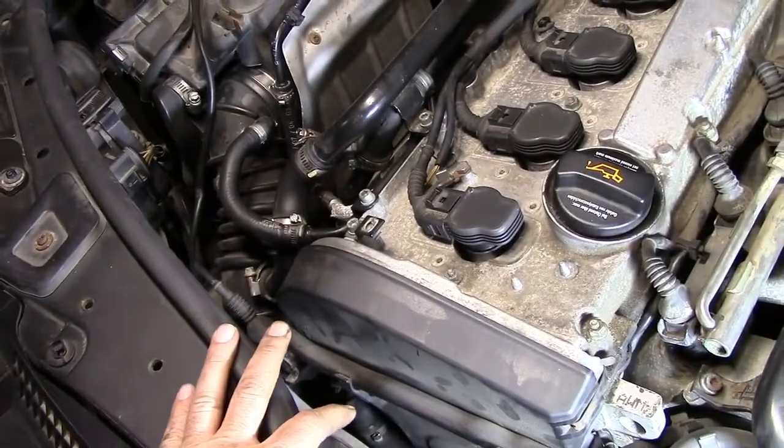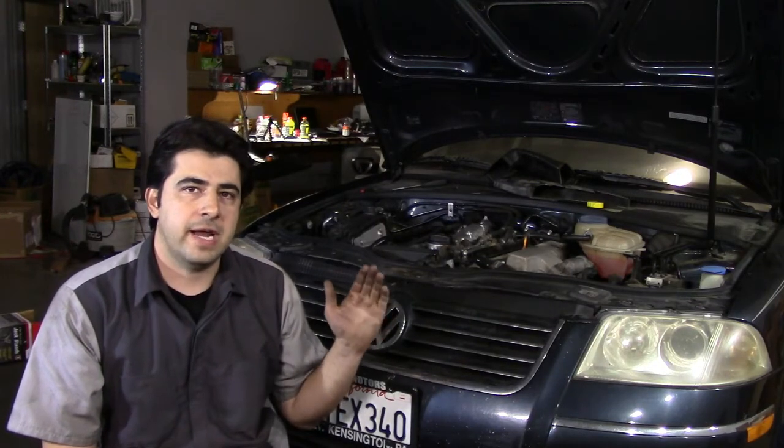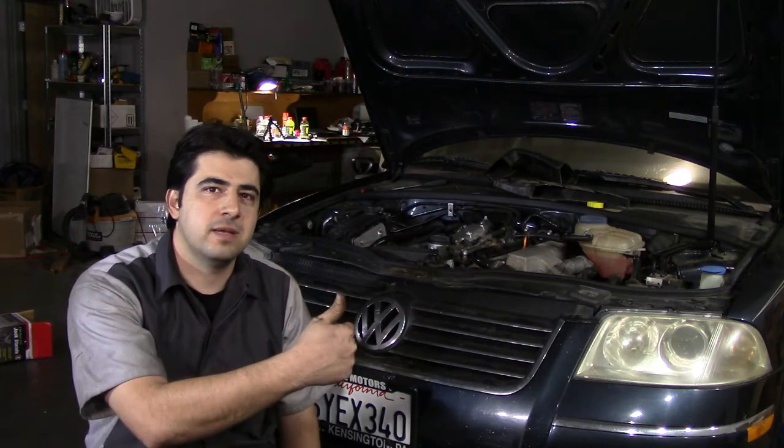And there you go folks — that was a walkthrough of a very basic turbocharging system. The whole purpose of this video was to familiarize people with how a turbocharger works and what the different components are that make up the system. In a couple of days I'm going to make a video on how you can make a homemade boost leak tester. A boost leak is basically when you develop a leak anywhere after your compressor wheel — through the hoses, piping, intercooler, all the way to the throttle body — and you lose compressed air, resulting in a big decrease in power. If you have your own boost leak tester you can find the leak, repair it, and get back on the road. If you want to see that video, please subscribe, and if you liked this one give it a thumbs up. I'll see you next time, thanks for watching.